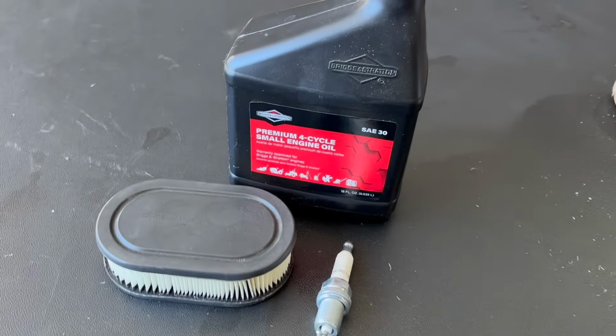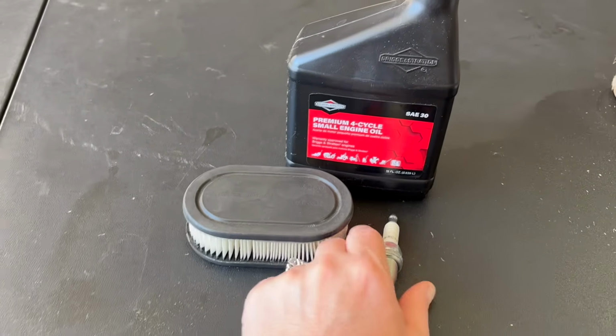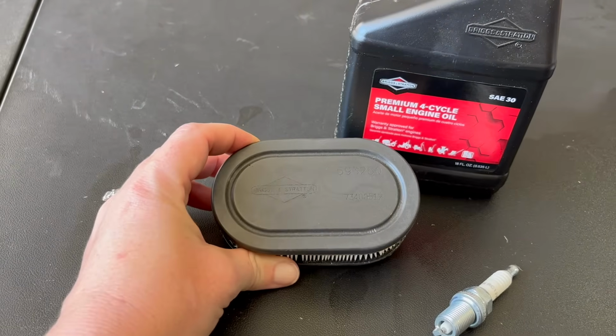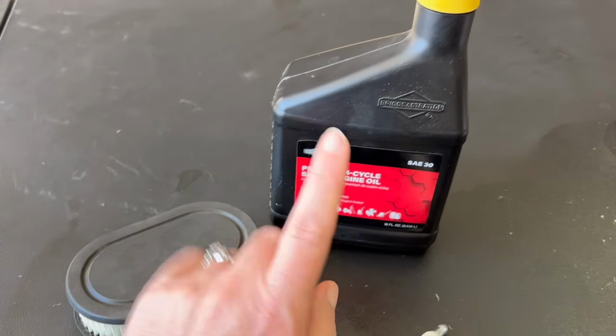If you have this mower and you're planning on doing a service, I will leave links to what you will need in the description box below. It is an overhead valve, so you're going to need an RC12YC spark plug. You're going to need a 593260 either Briggs and Stratton or comparable air filter, and some oil.